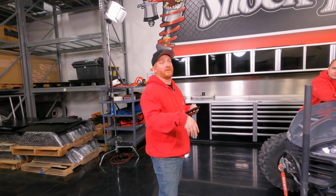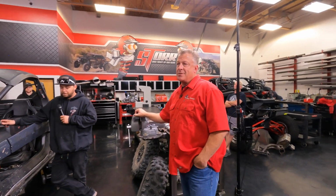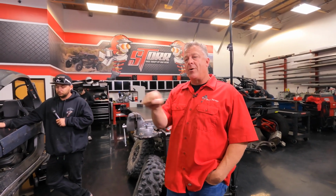I know, Justin, you were talking about there's some street cars that actually do that. Yeah, most on-road vehicles, especially electric power steering stuff these days, start pulling the power away when you're on the freeway, because you don't want that twitchy, easy lane change. You want it to be something slower and require a lot more effort. But when you drive slower, you get more power. So we were wondering if that was actually done on purpose with this.